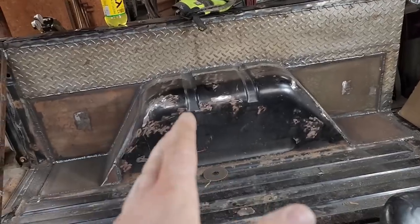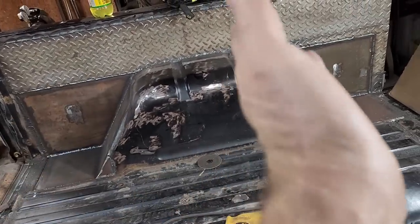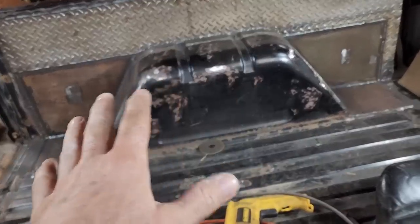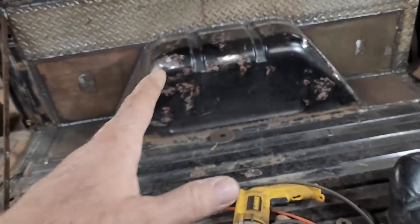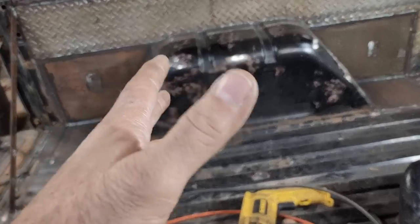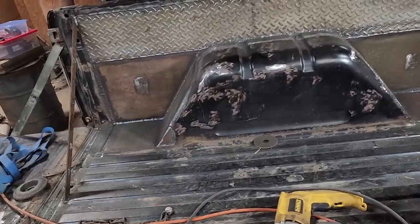Get back over here so I can. I got rid of that entire wheel well and just built my own out of tread plate, in the same basic shape. What's that? Oh, trapezoid? I don't know what you call it. But yeah, the same basic shape, just without the rounded corners, and made it all out of tread plate, whatever, 1/8 inch, 1/16 inch. And that would have added a lot more strength too to mounting the roll cage to those points.